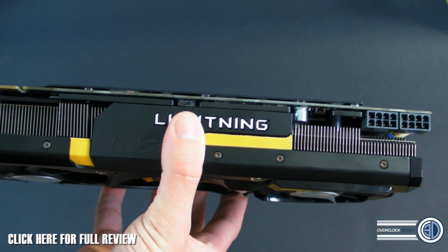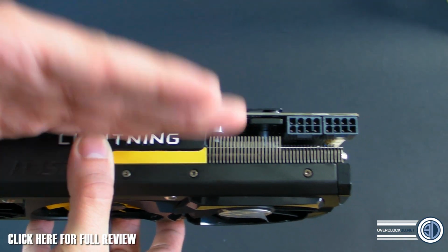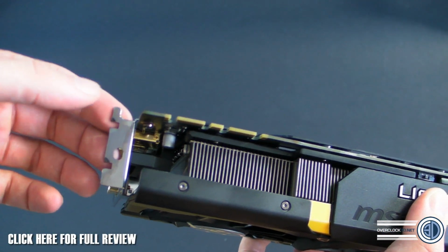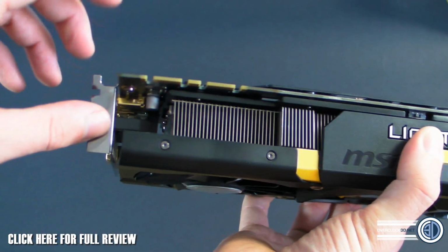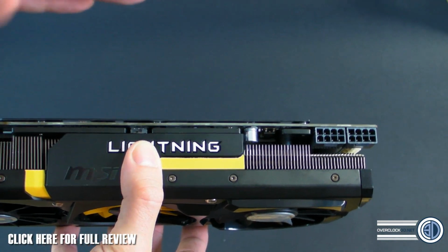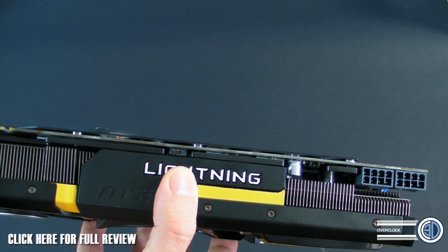And in our motherboard, when we tested it, it did still seem to droop a bit. Now, the card was perfectly straight, so it was probably just the bolting in the back, and you'll see when it's in the rig. You will need to do these up really, really tight, and when you do them up, you can straighten the card out. So it's not the card that's warping when you have a look. It's actually just shifting the slot, because it is fairly heavy.